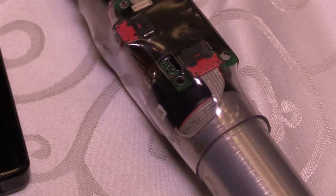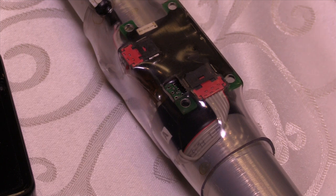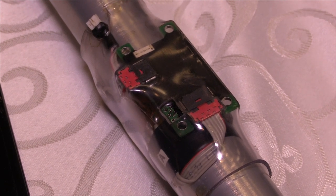Andre here for the High Performance Academy, and we're here with Doug from TCAT Performance Sensors. We noticed quite an interesting technology that TCAT are showing here at PRI: a built-in strain gauge which can be applied to crankshafts, drive shafts, and axles to measure the torque being produced by the engine in real time as the car goes around the track or down the drag strip. With seriously powerful cars — particularly top fuel dragsters — it's not possible to measure power in the conventional manner on a dyno, so this is a way of measuring torque in real time as it goes down the strip.